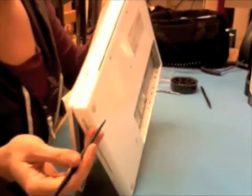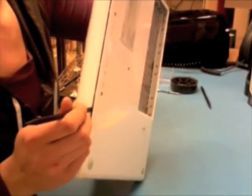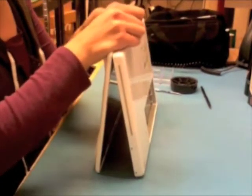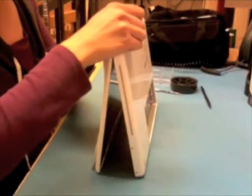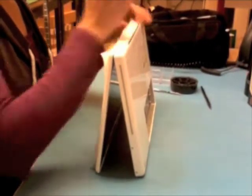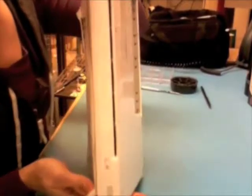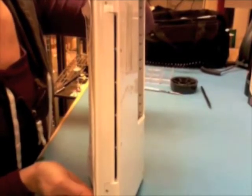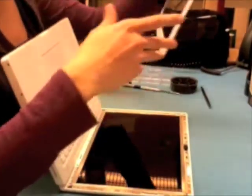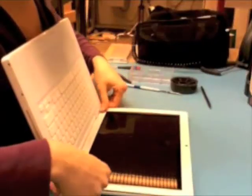The way that I'm going to reseat this is that I slide my black stick in between the bottom case and the rear of the clutch cover, and I use that leverage with just a little force on the display rear housing to snap it back into place. It really doesn't take a lot. You hear that nice snapping sound, and now it is all nicely seated. Flip it back over and get my bezel popped back in.